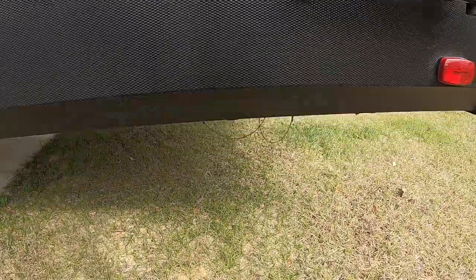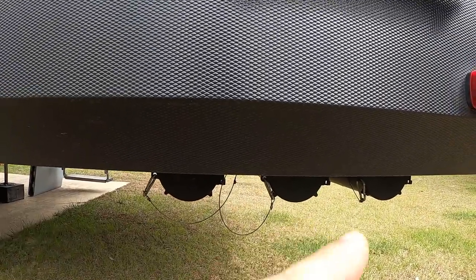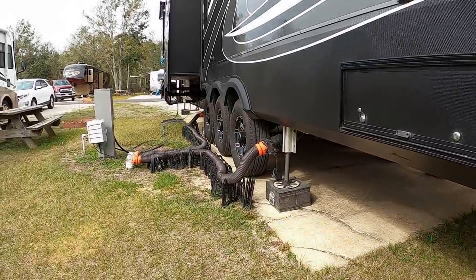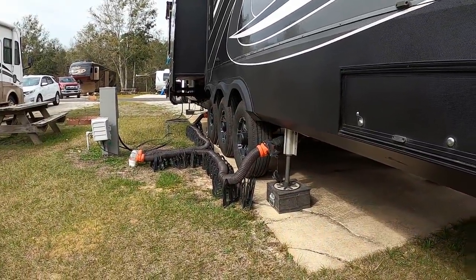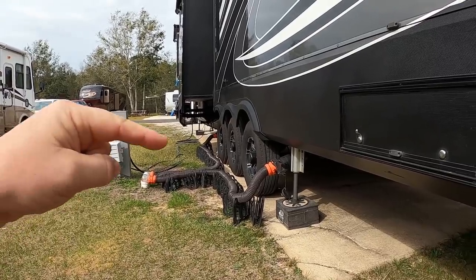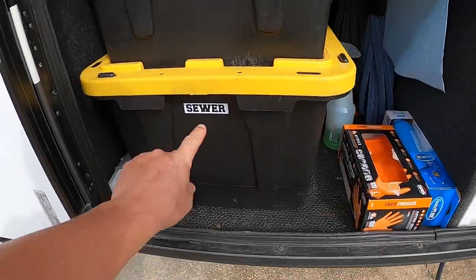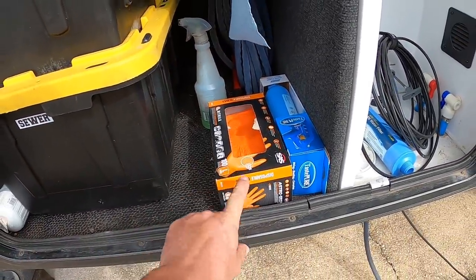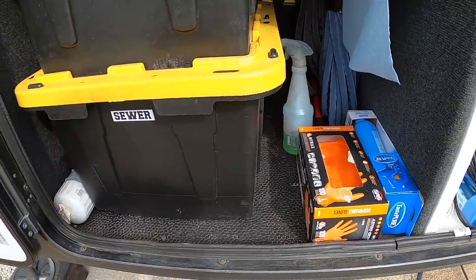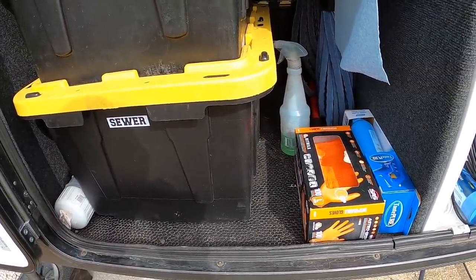While they're draining I'll come over here and start getting all of my sewer tubes ready. When we bought this camper we only had one; I installed two more so I have three sewer tubes available. Sometimes when the sewer hookup is in a weird spot we need two tubes for the front and one for the back to make it reach. We have a whole box just for our sewer stuff, and these gloves are a must when you have to touch sewer stuff.